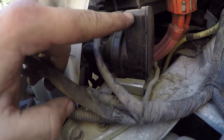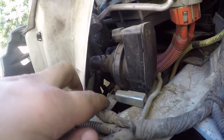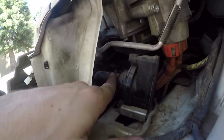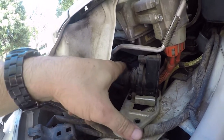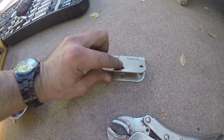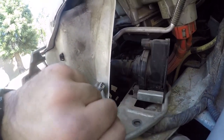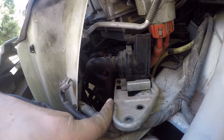Now you have access to your inverter coolant pump right here. It looks like it has two 10mm bolts holding it in. I'm going to take those off, unplug the electrical connector, then clamp the hoses before removing them. Here's a trick so you don't have to drain all the coolant: when you take the hoses off they will leak because the reservoir is way up high. I've got a door hinge from the garage — put the hose inside it and vice grip it shut to essentially crimp the hose and stop the coolant flow. I'll only do the top one and hope gravity holds the rest.